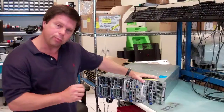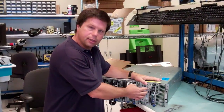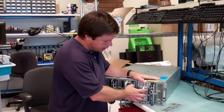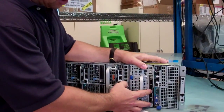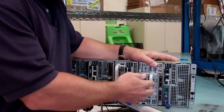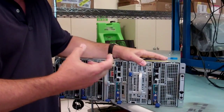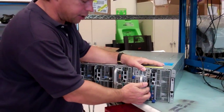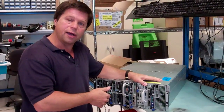There are really two parts of this sled. One is the static portion that presents the SAS connectors — each connector has four channels. And then behind these connectors on a board are the expanders, which are responsible for routing the external-facing SAS signals to the appropriate drives on the inside.